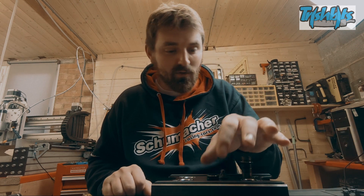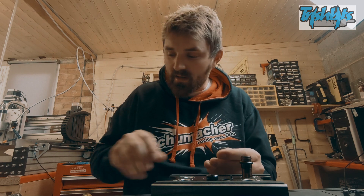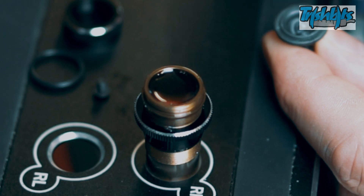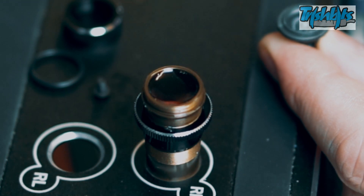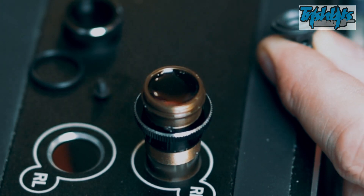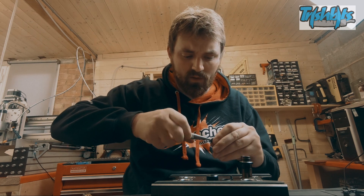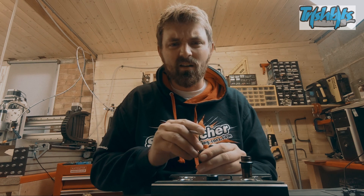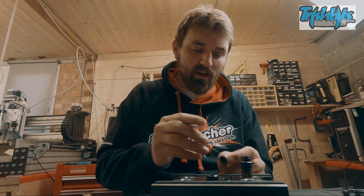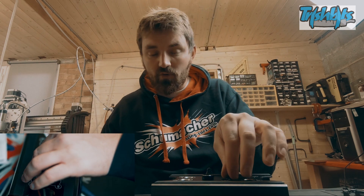The shock cap is very important because it keeps the oil in the top. Check the quality of the molding - check for any flashing on the edges. If the flashing from the mold line is tall, the oil will work its way out. I've already made my hole in here using a reamer. If you don't have experience with reamers, use a drill - come in from the more desirable end and drill it through. Then I'm going to screw this in place now.